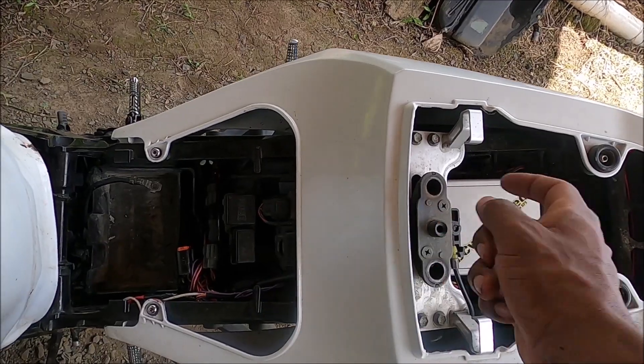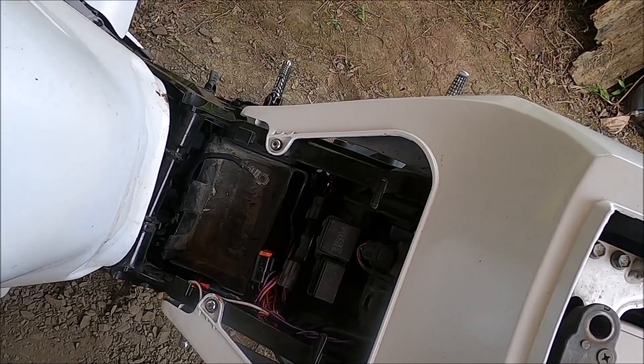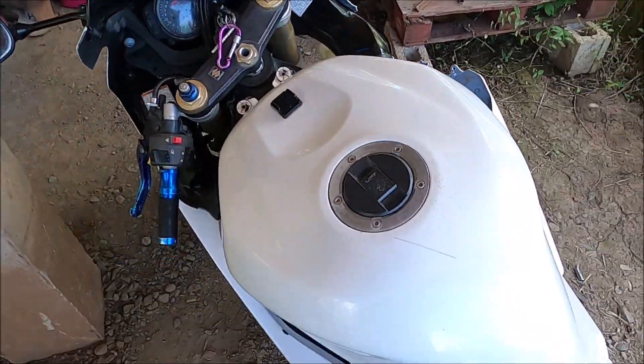That will conclude the wiring. I'm not sure if I'm going to run a vacuum line to the ECU — I'm probably going to do without it for now. After that I definitely want to monitor fuel pressure. It's hot, so I'm going to break for lunch, and after that I'm going to attempt to start it. It may start, may not start, I don't know, but we're going to do a function test and if all looks good we'll attempt to fire it up.